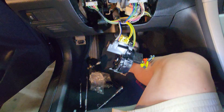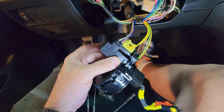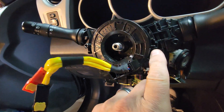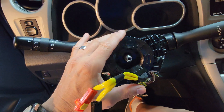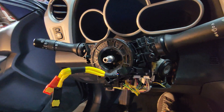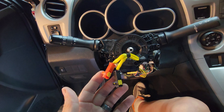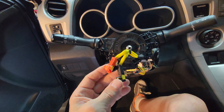Do all that as you put it back together. They all click in place properly when you reinstall the wiring harness — there's really no guessing. Everything just clicks right in, and it can really only go one way. You've got these little hooks and everything just hooks in and you push it in place. These will connect to the horn mechanism of the steering wheel where the airbag goes, and they only go in one way as well by color coordination.